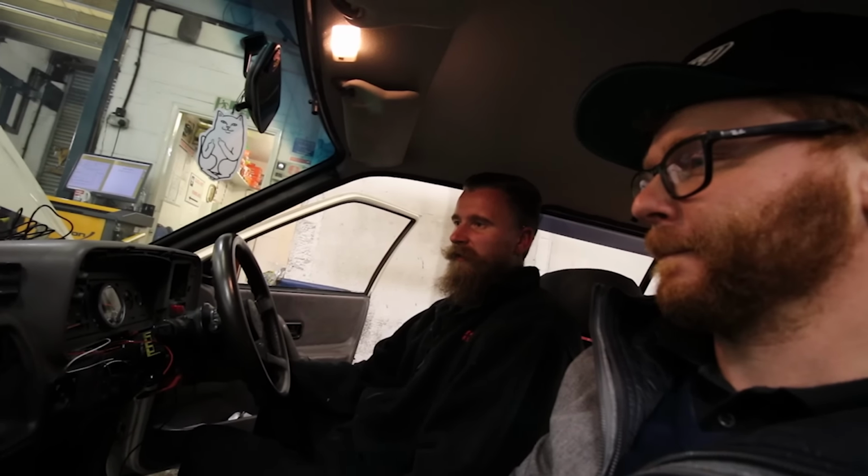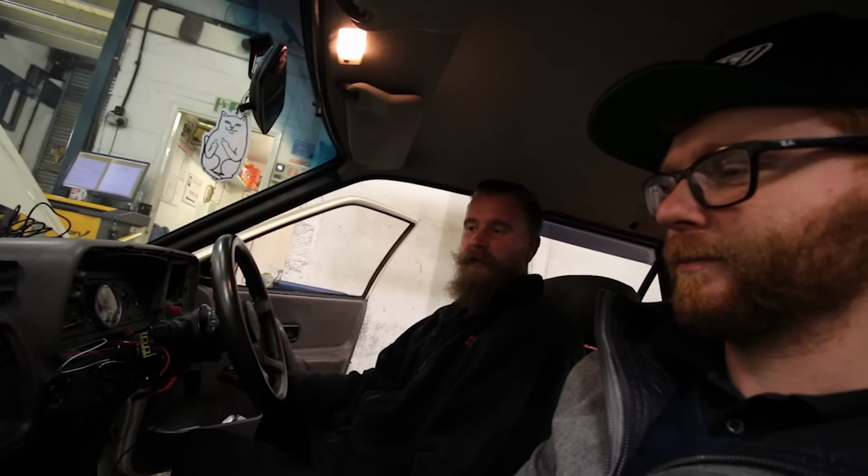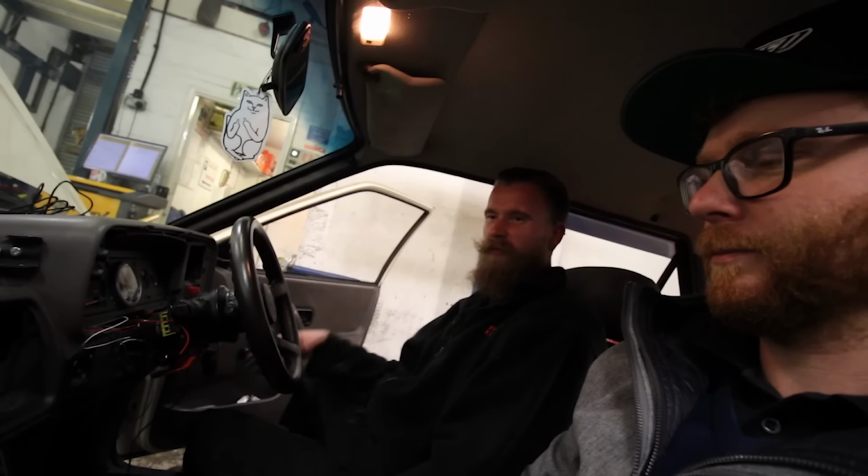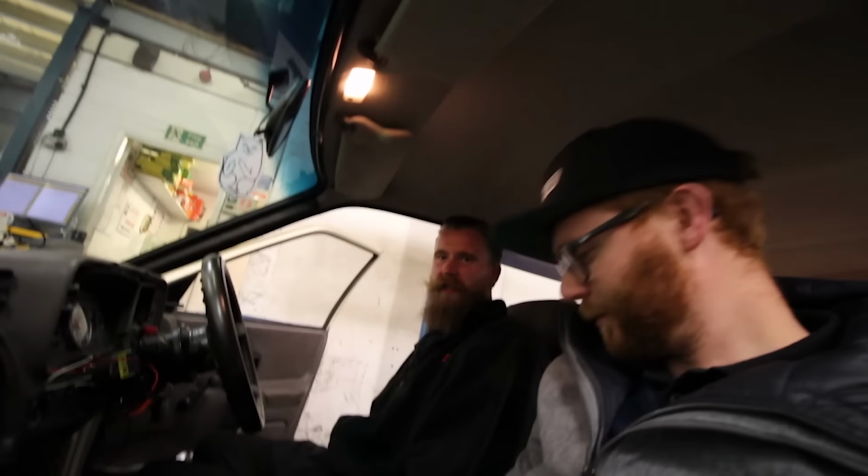No, so all I did is I put in all the numbers for what sensors I was using, injectors, everything else, and it sort of wrote a base map. I don't really know, but there were numbers in all the boxes. I fired it up. It fired up mint. It was rich as anything. I was taking about 30% of the fuel out of the fuel map.